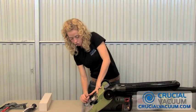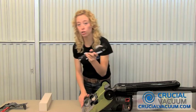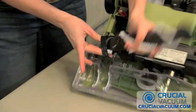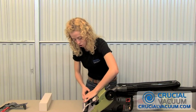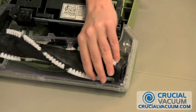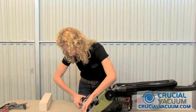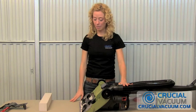It's nice and stretchy, so don't be worried. You might need to work on it a little bit and get that brush roller. This is the area where the belt goes, so you want to stick it in this way. It's supposed to be snug — if it's too loose, it wouldn't do its job. When you pop the brush roller back in, do the side that's further away from the belt first because you have a little more give there. Slide it in while holding down this side, and once that's in, hold down that side and pull it down.